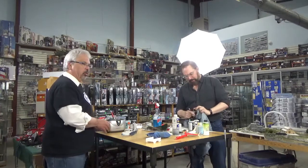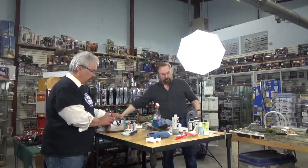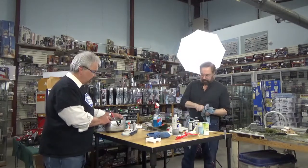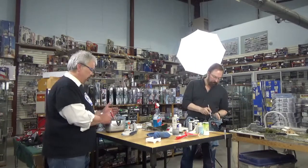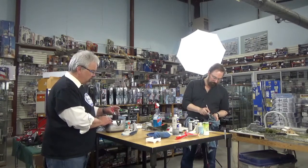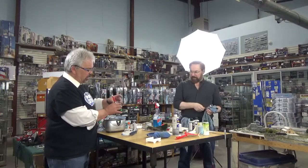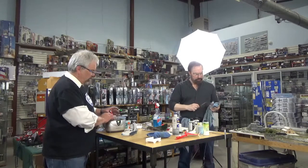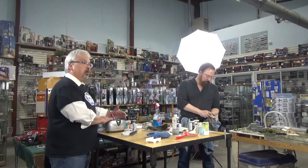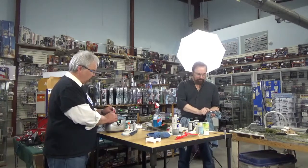People are probably wondering what I'm doing back here between all these paint changes and stuff. I've talked about this before. We typically carry these in stock. We're out at the moment, but we'll get them back in. This is called an ultrasonic cleaner, and it was designed to clean dentures, jewelry, eyeglasses, all kinds of nifty things like that. It's just a very vibrating chamber. So what I do is I have a glass jar with lacquer thinner. See the color? That was clear when I started it. So I put it in this glass container. I put it in my reservoir, but I put water in the reservoir. So what I'm doing is I'm keeping all my thinners and gunk in my glass jar, and I'm keeping my ultrasonic cleaner clean.